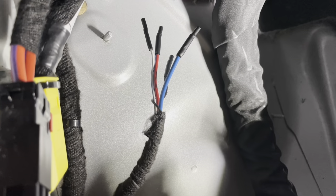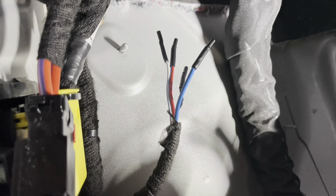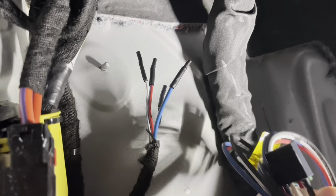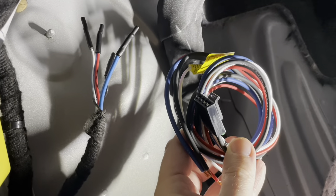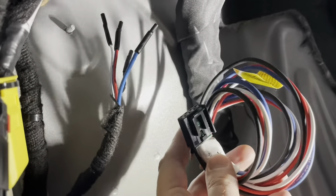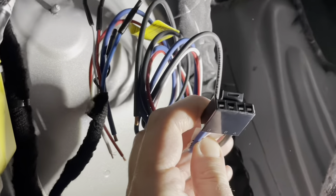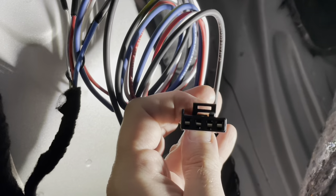They used to make it easy on you — you could just get an adapter wiring harness that would plug and play right into a place on the fuse box, and you wouldn't have to do any wire splicing. But it looks like GM's getting away from that. So what I've done is, in addition to our brake controller, I've gotten a universal wiring harness. This will work for any application — you could use this on an older 1995 pickup truck or one of the newer vehicles that doesn't have a connector from the factory. The biggest thing is you just want to make sure it has the same style plug, and this one matches up with the pigtail coming off of our brake controller.